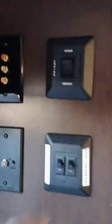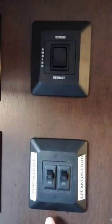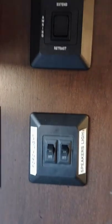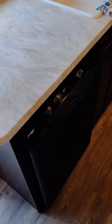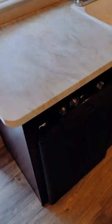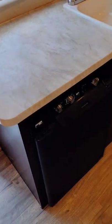Interior of the travel trailer. We have our awning control, our light controls for outside. When you get ready to use that awning, make sure that door is slightly closed so you don't bend the awning. You should have your propane gas on the outside already open.